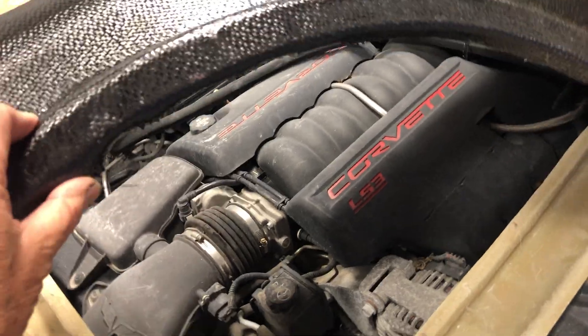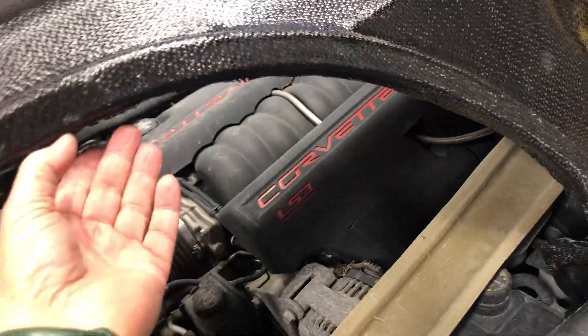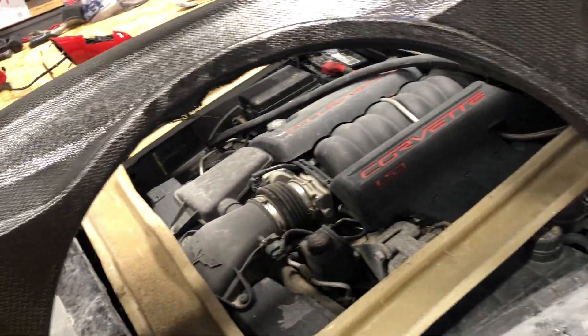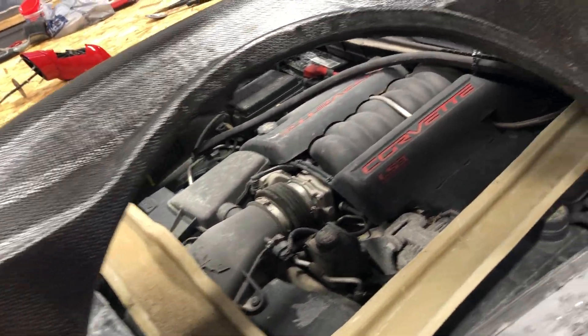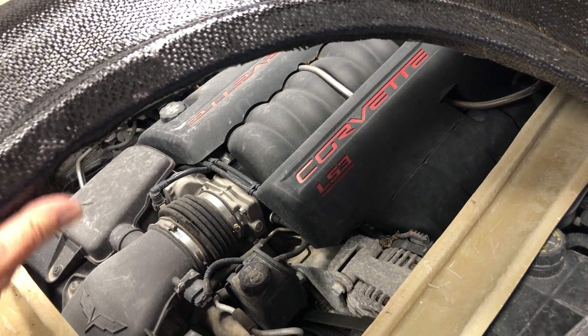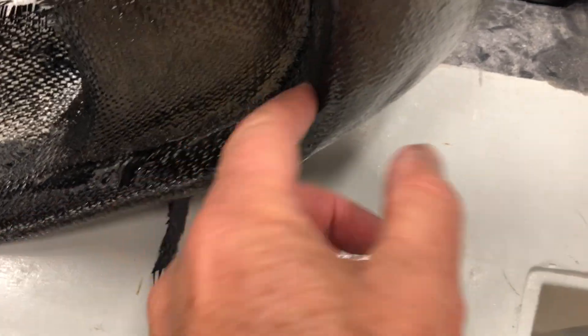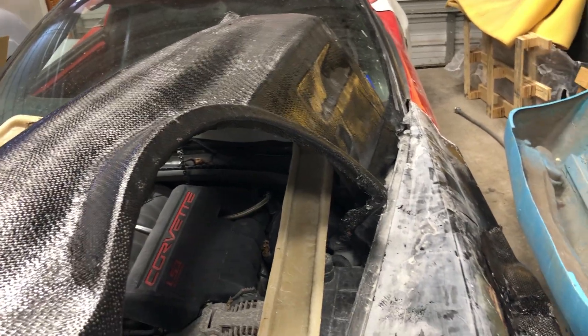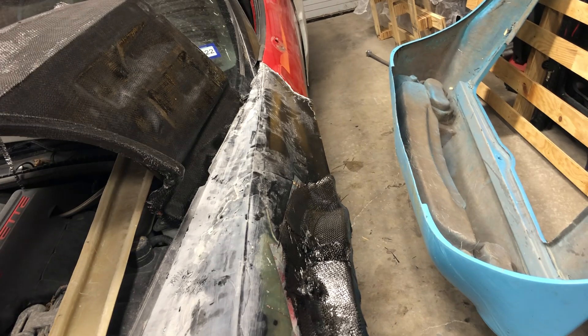The advantage is we were really careful when we made the fender flares. The hard part is getting this inner lip, and the reason why that's so hard is it can cause the part to be mold bound, so we went ahead and made sure that was good. When we removed it from the mold it was a little bit mold bound. I knew that going in because I decided to go around the nose here — I probably should not have done that, but by going around I've got some extra material I can work with. There are a few little bumps, and I'm going to sand this one smooth before we put the third, possibly final, layer on it.